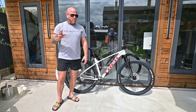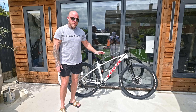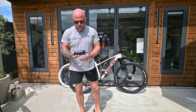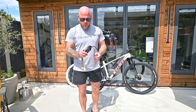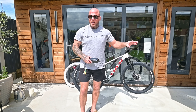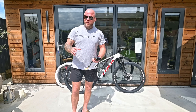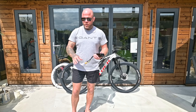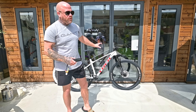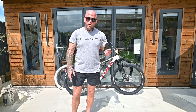Let's get the back wheel off and prove whether we can or can't fit a 12 speed. Going back to the battery quickly — I believe it's got an 80 amp BMS. There is a slight possibility I may increase the standard controller. This is the standard sine wave controller — lovely and compact, nice and quiet — that comes with the Curvy Bike Kit. It's got the new style plug for the phase cables. With this battery and BMS there is a possibility of upgrading the amps, which will give us more acceleration. I've got a couple of 60 or 80 amp controllers but they're more geared towards 3000 watt kits and have much thicker phase cables, which may cause an issue.